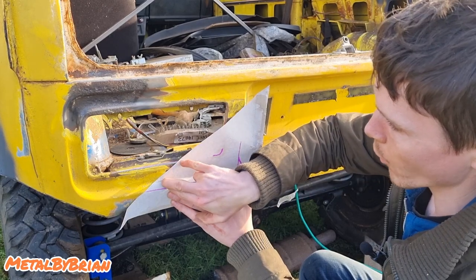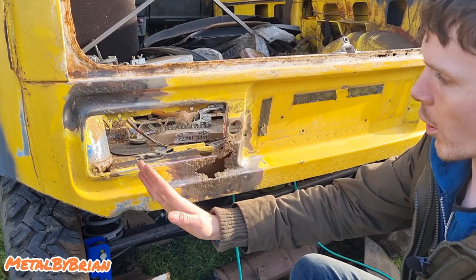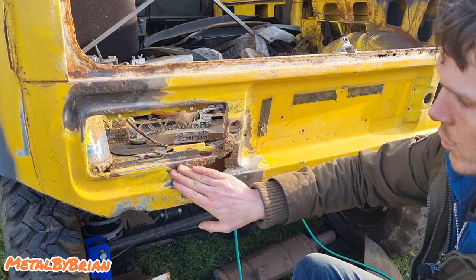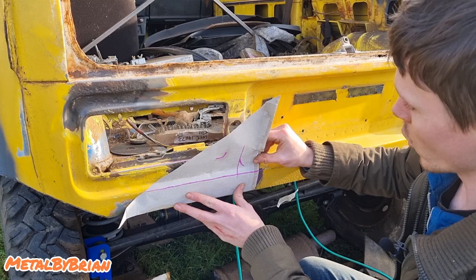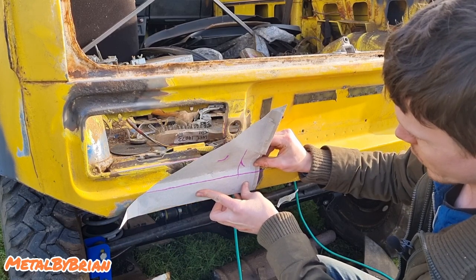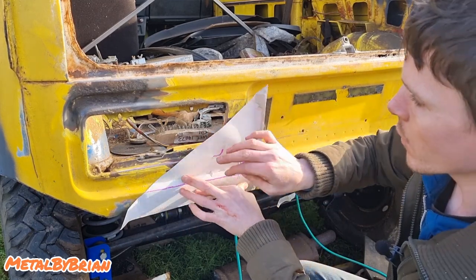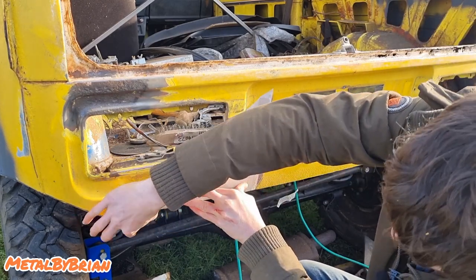I'm past my rot point, you see. I'm past any kind of surface corrosion. Because this has got a big hole here, I'm working past to the shiny metal. Yeah, so even this bit here that's got that sort of surface corrosion, because I'm replacing this anyway, I might as well chop it all out, and that's 100% going to make it last a lot longer than if we just work to our bare minimum. Sits in there lovely.